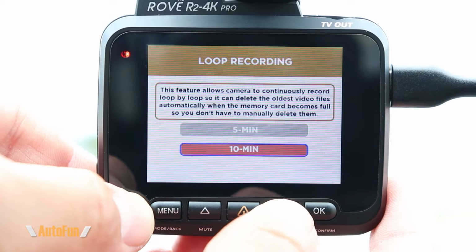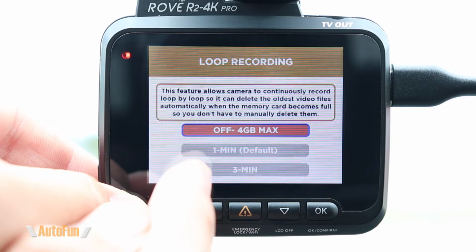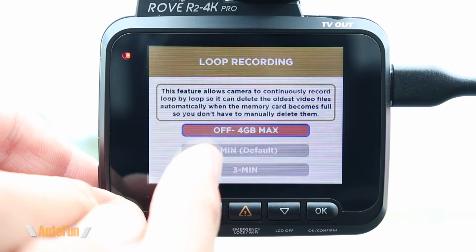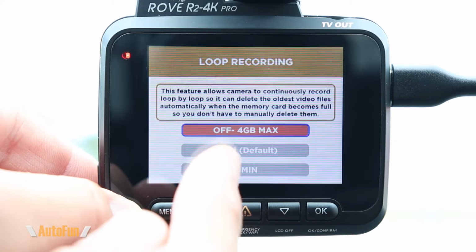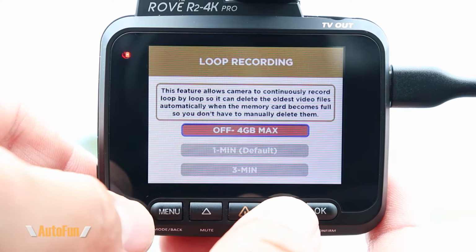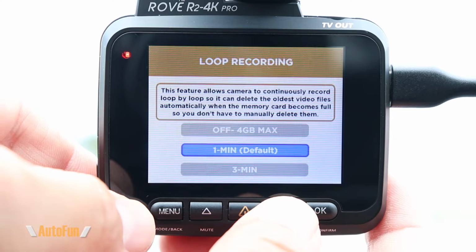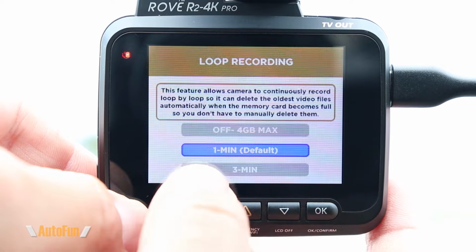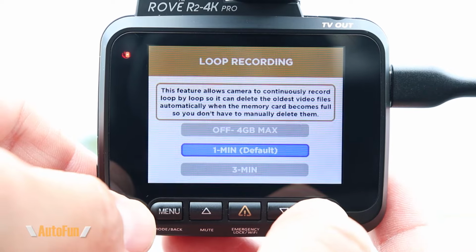Now what's interesting is that this dashcam also offers the option to turn off loop recording, and then it's going to record video clips up to a maximum size of 4 gigabytes before starting the next video clip. Now I do not recommend you turn off loop recording. I would say pick either 1, 3, 5, or 10 minutes. I personally think that the 1 minute default recommendation by Rove is a good one.